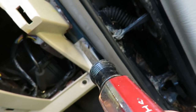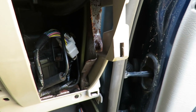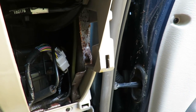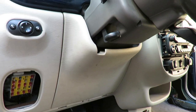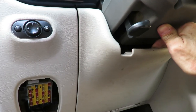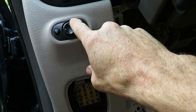Take off that screw and that one — that pretty much releases everything. There's a metal frame inside behind your dashboard that everything is connected to, and that frame is connected to the car. You just take what's connected to the dashboard off the car and disconnect the two of them — everything comes off in one piece. And there's what we're trying to get to: inside there is your heater core. On the driver's side, the piece underneath your steering column tips down to get to the two screws that hold the side panel on. Pull really good — boom, you're done. This panel comes off just like the other one, then disconnect the electrical from it.